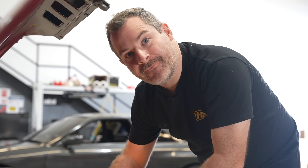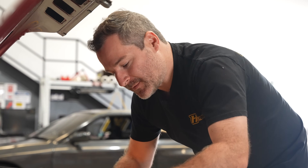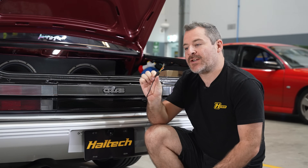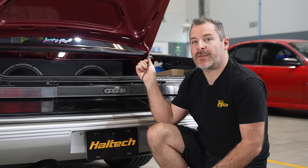For this specific install, I've found my reverse light bulb and I'm double-checking which wire is my reverse light power wire. I'm going to connect my white wire up to that wire. I've got everything in the back of the car mounted and wired, so now I just need to feed the dash end of the harness through to the UC10 through the interior of the car.